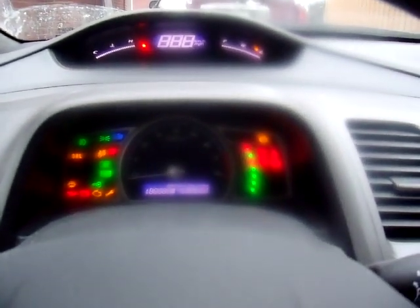As you can see there is the tachometer needle going. All the lights are flashing, and up on the top it's showing 888 to demonstrate that all the LCDs are working. Temperature, fuel, the low fuel light, the overheat, red lights flashing. Down at the odometer it's all lit up in the eights — kilometers, miles, service oil life, everything. Now if you want to make it do the sweep again, all you simply do is press and release the trip reset button.